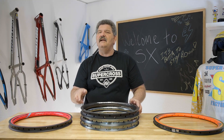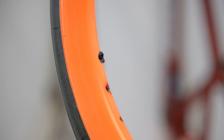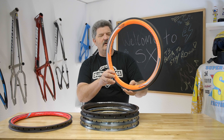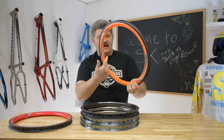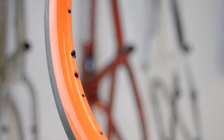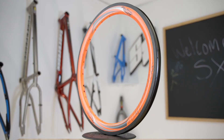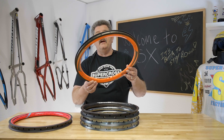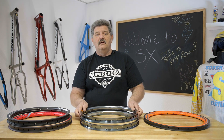With the RCRs, here's a perfect example. If you can zoom in a little bit close on this — you can see this was Bella's wheel at Worlds, from four or five years ago. When she was racing, someone's pedal caught her spoke. Her spoke snapped, and as it snapped, it actually ripped right out of the wheel and started wrapping around her hub. As the spoke ripped out of the rim wrapping around her hub, the rim stayed true. She was still able to race — she was able to finish Worlds on a carbon fiber rim. Had she had an alloy rim, she would have had all the spokes ripped out and the race would have been done.